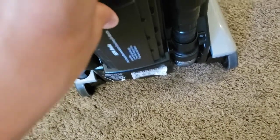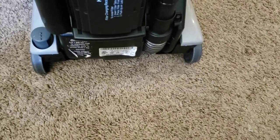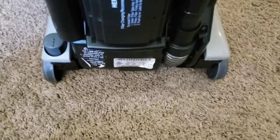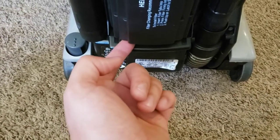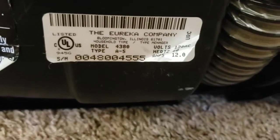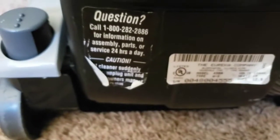And what I thought was interesting with this machine is there's a clear rear piece on the motor that actually diverts all the air up through that little hole in the bottom here to go through the filter. I was kind of wondering how they would do that. But this thing should be working as it was supposed to, because I did replace both the motor bearings.